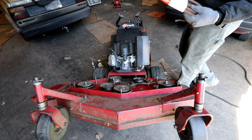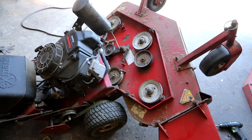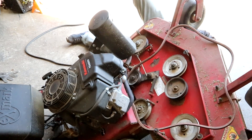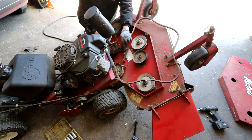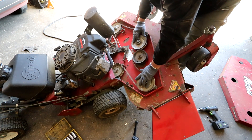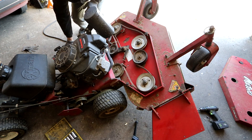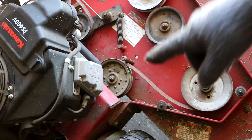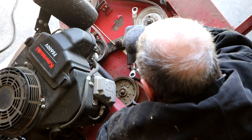The belts are not cheap — this is a generic belt and it cost me 45 bucks. Now we put the belt back on: reach out here and put it over the main drive — here, here, and here. We may have to adjust the tension because it's a new belt. Then all we have to do is tighten up our pulleys, and this guide piece here needs to be tightened down. You have to develop a third hand to get this on.